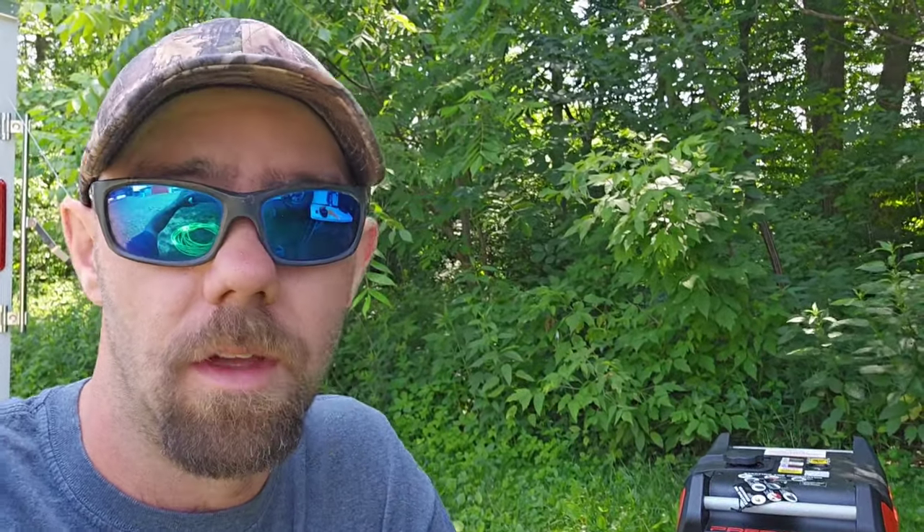Another common comment was my camper's wired wrong and I need to hire a real electrician to diagnose this. Well, for starters, my mom told me I could be anything I wanted to be when I grow up, and it's 2023, so for the purpose of this video I'm identifying as a real electrician. Through the process of elimination I proved my camper wasn't wired incorrectly — being that it only runs goofy off of this generator and it doesn't run goofy off of the bigger generator, solar, or plugged into shore power. If it was wired incorrectly, all of those power sources would show the same result.